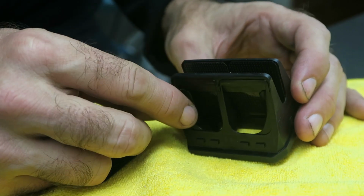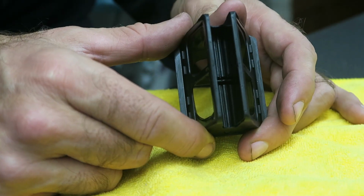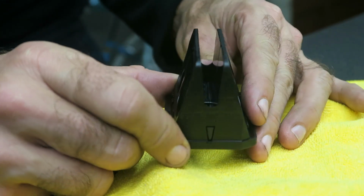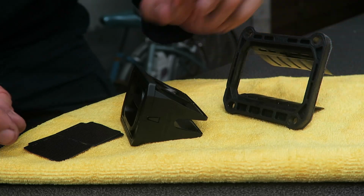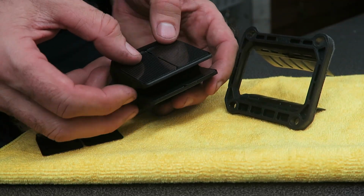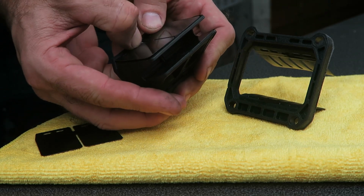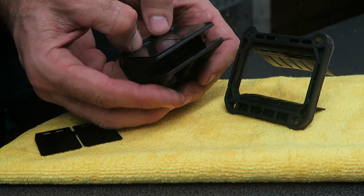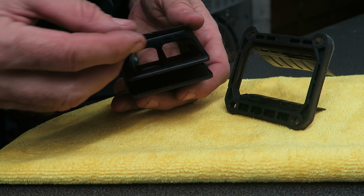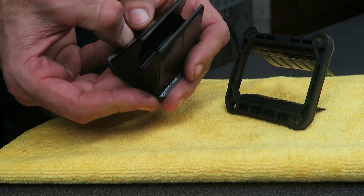And then once you put the retainers in, make sure the reeds are seated correctly against the reed cage. So that looks good. Okay, now I'm ready to install the outer reeds, and this is pretty easy because you can see where the tabs are very clearly on the reed cage. So just line it up and then press them onto the tabs, and do the other side. Press it on.